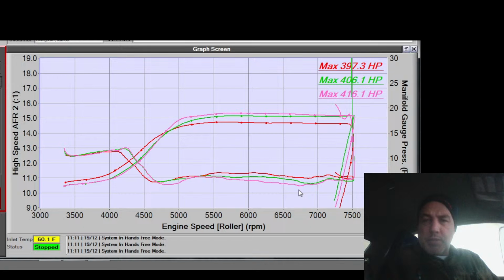On a Subaru in below freezing temperature, an issue that can't be fixed by a tune. Is running E85 on a Subaru in below freezing temperature an issue that can't be fixed by a tune? I don't know what that means. What do you mean? What's wrong? Do you mean starting the engine? Yeah, you're fucked. With port injection? Good luck. Yeah, that's tough. A low compression engine that's made of aluminum in freezing cold temperatures with ethanol. If you're at 85%, you're going to need really big coil packs with a huge gap on the spark plugs to hope to get that thing to light. That's tough.